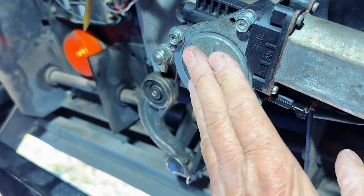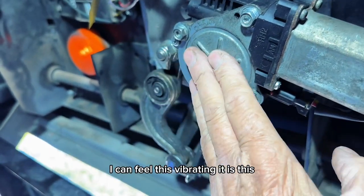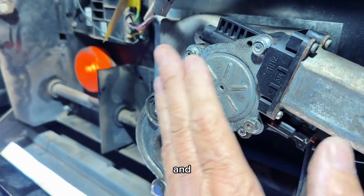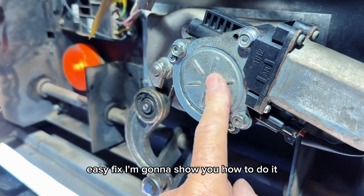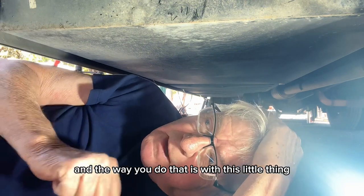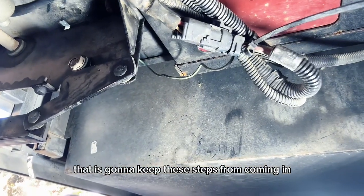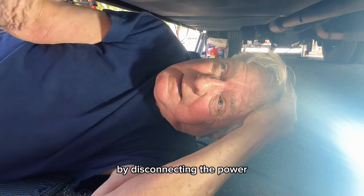When I close the door I can feel this vibrating — it's either the motor or it's binding in the gears. There's a big gear in here; this is not run by a belt, it's run by gears. The most common thing is the motor — easy fix. The absolute first thing we're going to do is turn the power off. You do that with this little connector right up here. We disconnect that to keep these steps from coming in accidentally and putting a hurting on your head.